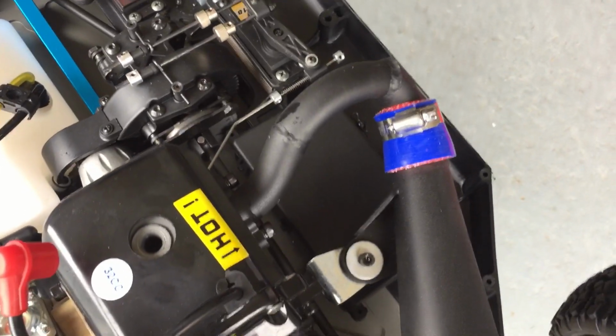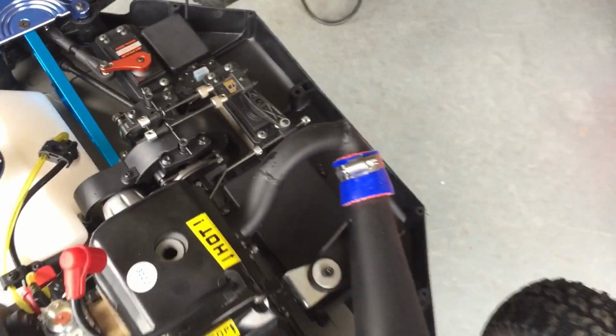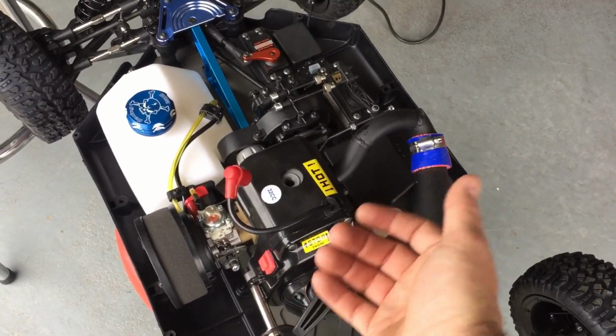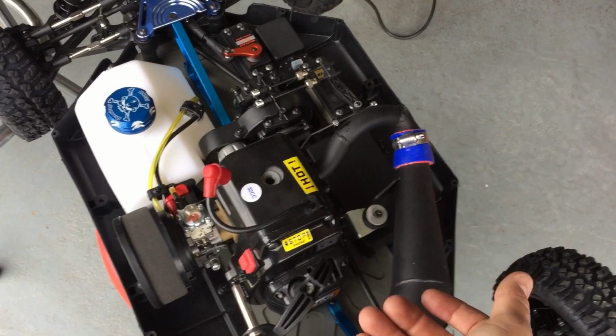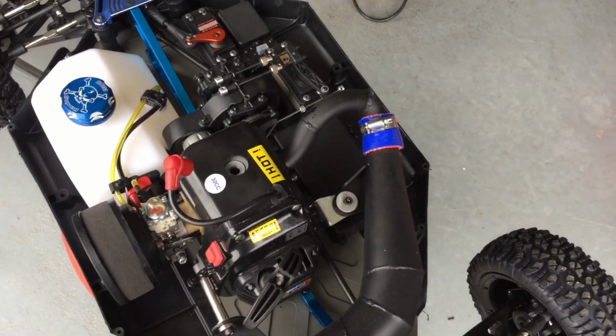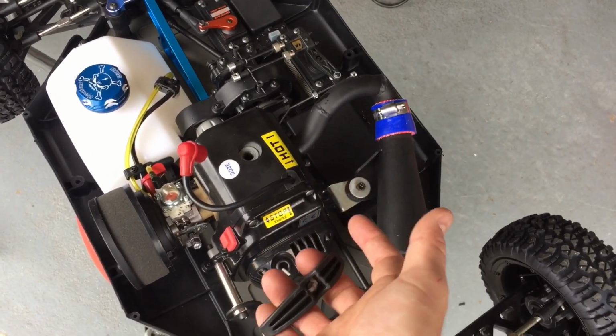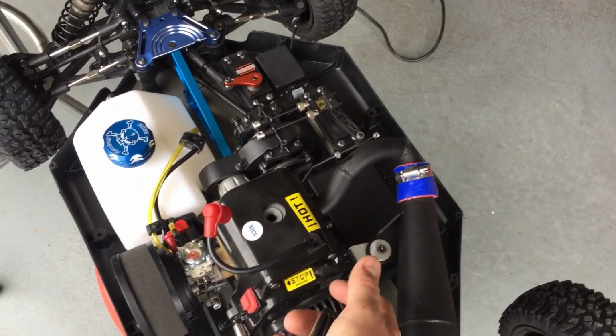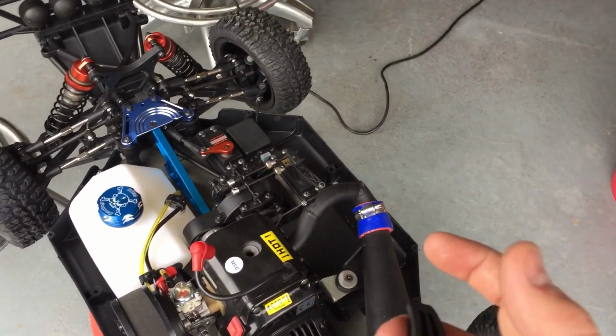See that oil, that shine in there on the piston? I don't know if you guys could see it. Go up and down, see? So much smoother. Before, my buddy said, oh man, why is it stuck? I'm like, stop what you're doing, because you're gonna scratch that cylinder. Look how much easier it is now. Now you work it nice and slow, work the piston up and down.